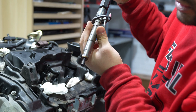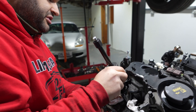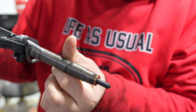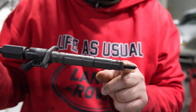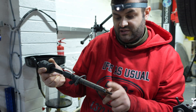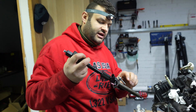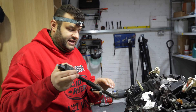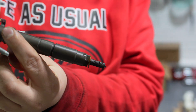This one is worse — that carbon buildup — but I wouldn't say they're in a horrible condition whatsoever. Number three: that's a little bit of dirt, definitely needs refurbishing and cleaning. You can see the end — that washer needs replacing as well, it gets crushed so it needs replacing. Number four — it looks scary but I think it's okay. Number five: more or less same condition. The good thing is they're all in the same condition, not one worse than the other. Number six — again, same condition.